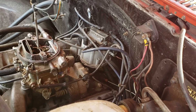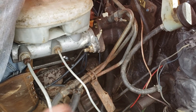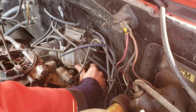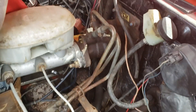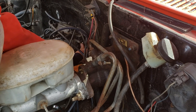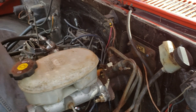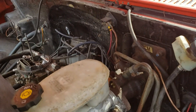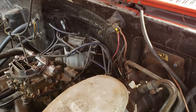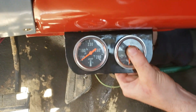When installing your line, you can take a heat gun and lay it straight — it will help the plastic straighten out and it's a lot easier to deal with. I went ahead and reused my old line from my previous gauge. When snugging these up, you don't want to over-tighten them because it will start twisting the plastic line. You don't want to over-tighten it or you can kink the line.